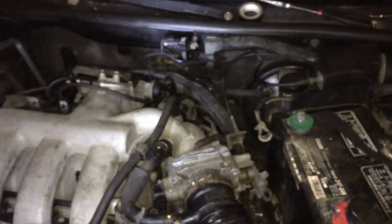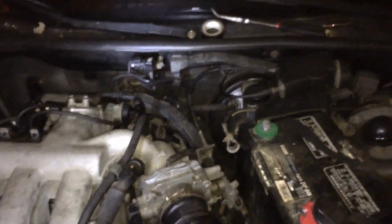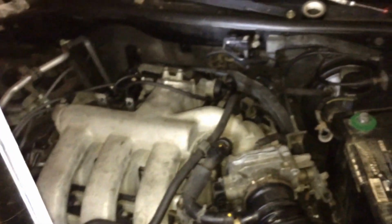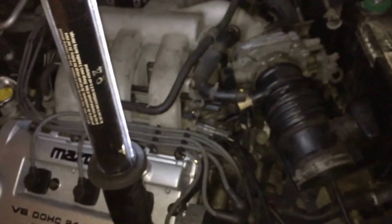And he tells me, "Well, it is a great car if you actually find it in a 2.5 engine." The one he was selling was a 2.3 with a Miller engine, which basically has a supercharger, and those are known to be problematic. Oil consumption, oil burning. The chargers are extremely busy and extremely pricey. This car alone, without the Miller engine, the parts are expensive. The mounts are pricey. But I'm a firm believer that if you take care of your car, the car will take care of you. Some cars may require more love and attention than others, but just keep that in mind.